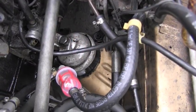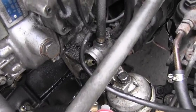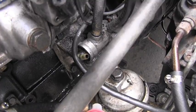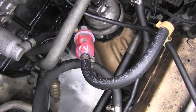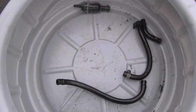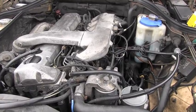Here you can see the brand new line — the red is the pre-filter, another new line, and the lift pump down there. That cleaned area and that open nipple or inlet, that's the part which failed — that's the fuel heater. Those new lines are 5/16 or 8 millimeter fuel lines. Here you can see the bad lines and the old pre-filter. I'm not done yet — I have to start up the engine and check for possible leaks.